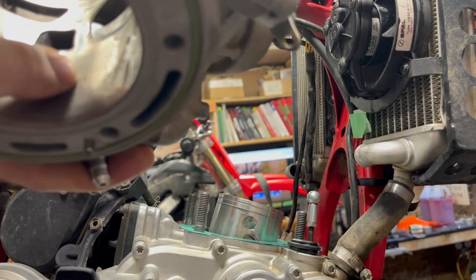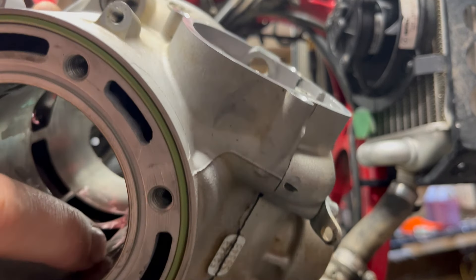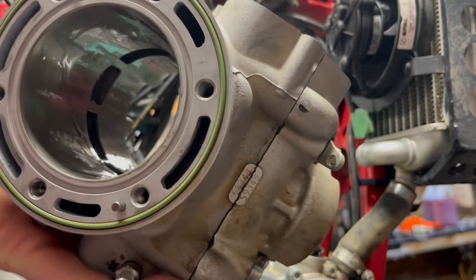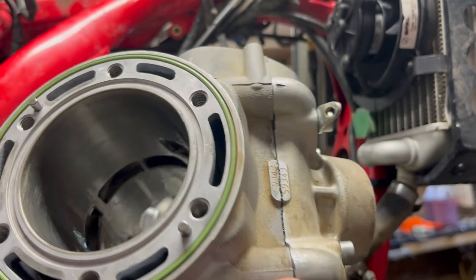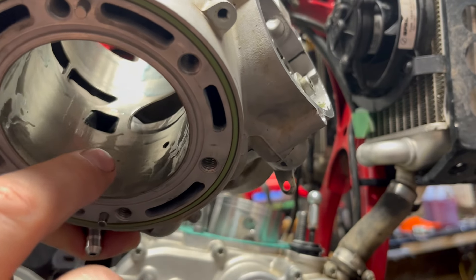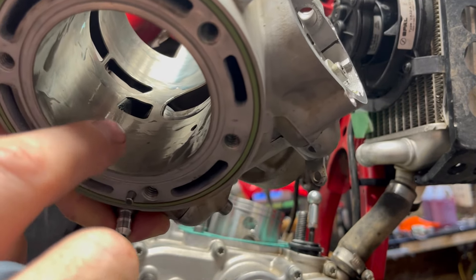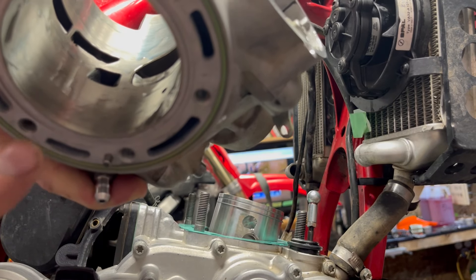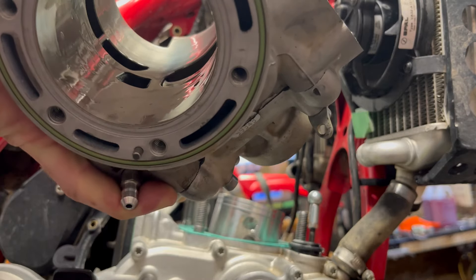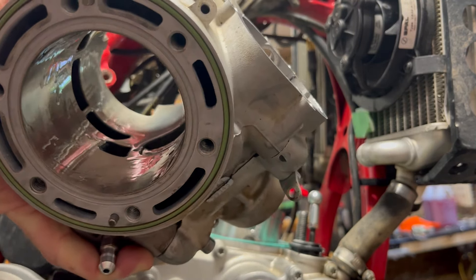I just noticed there's a tiny little flake off of my Nicosil in there — it's not a high spot; Nicosil is actually missing right there, I can just feel it with my fingernail. I'm not concerned about that. It's been running just fine, and having porosity or little holes in your Nicosil — sometimes you'll even get that with a brand new plated cylinder, especially if you get your cylinders plated at US Chrome. I don't really like the way that it looks, but basically that little hole is just going to hold oil. It's not going to hurt the ring, it's not going to hurt compression. It's going to be just fine.